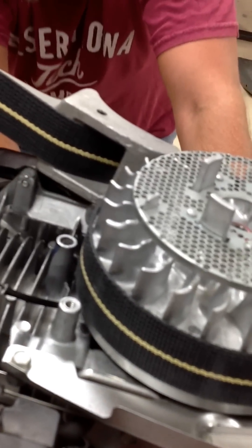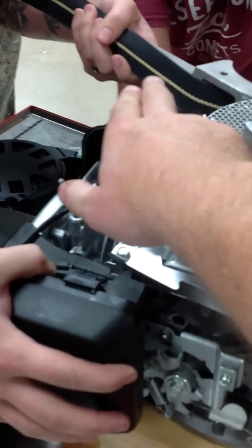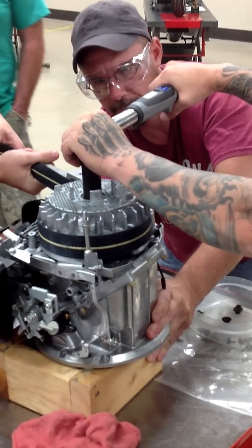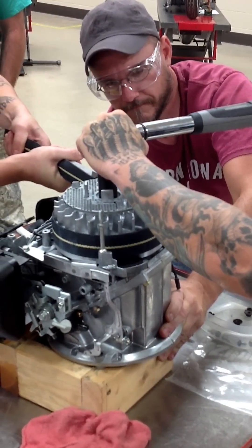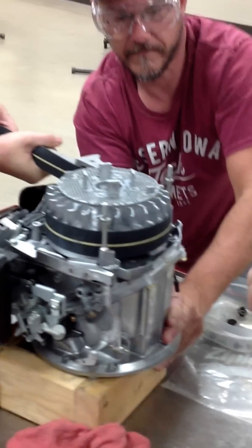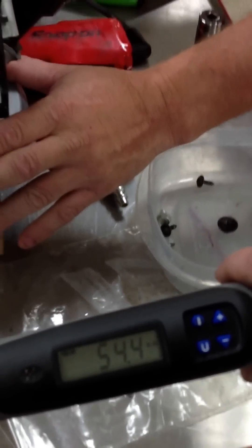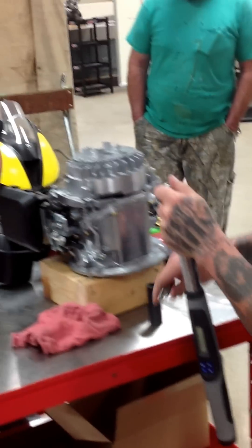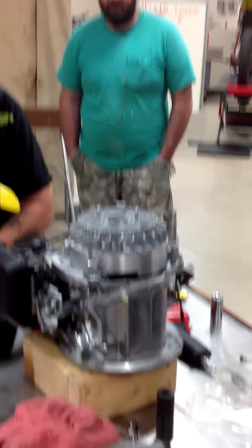Are we 100% secure now on where we're at? Yeah. See how you move that out of the way? Now you should just be holding the strap wrench here — we'll let Ross hold the motor. Let's go ahead and try to go that 55 pounds, being watching for any contact that the strap wrench is going to come into. We've torqued it — let's look at the wrench. What's cool about the digital torque wrench from Snap-on is it tells the actual applied torque: we had 54.5 right at that point. He did a great job of not over-torquing it and coming right into specification. That's how you properly torque a flywheel using the correct tools and not just grabbing the old impact and calling it tight.